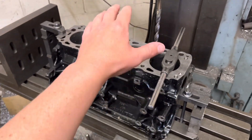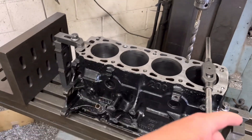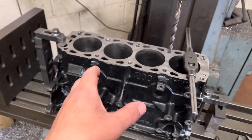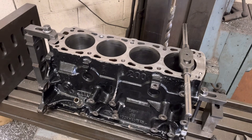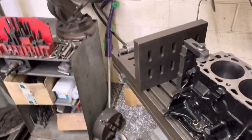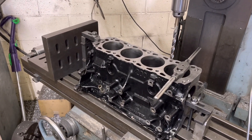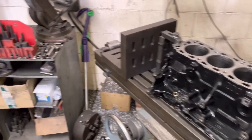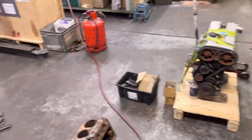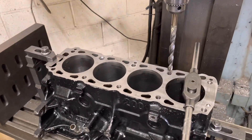Really impressed with the way Isaac's working at the minute. The first job for me this morning is to do a six long stud conversion on this Cosworth block, then put the oil jets in the base — the BMW ones that we use. This is my third one I'm doing, and then I've got another Cosworth block to stud and put liners in from Mr Dave Pritchard from DP Motorsport, who kindly brought that in Saturday. Pretty busy with the Cosworths today.